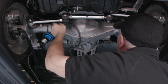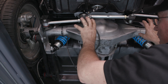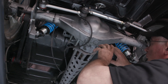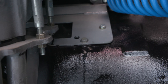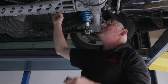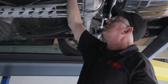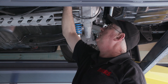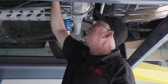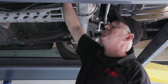This is all offset again for the option of putting bigger rubber. The way the shock absorbers mount into the floor — on the original I have a bolt-in frame — we use that as part of the foundation for anchoring the rear shocks. Then we reinforce that whole floor with a special fabricated upper mount crossmember. There are a few tricks to installing this, and it's really important to be aware that the original seat belt anchor point has to be removed. We've got the reinforcing front frame that picks up that same point, and we provide a couple of new nuts so you can bolt the seat belts back in.